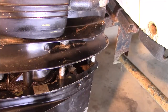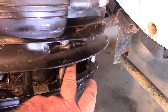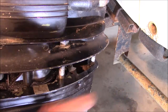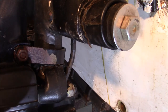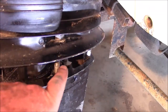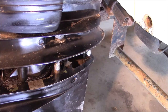So in forward gear, if you rotate forward, it's like that. Mine was sitting right about there. That's how you orient the shift shaft and the cam. And that cam is what releases the motor. Now what happens is when this shaft here drops down, when it goes down, that's what makes it go free. When it gets pushed up, that's what locks it. And yet again, when I look at this cam right there, there's a pretty steep face. And when it rotates counterclockwise, it pushes that shaft up, and that's what locks it in. So when you put it in reverse, the motor doesn't come flying back up and out of there.